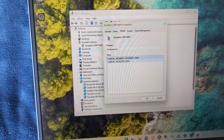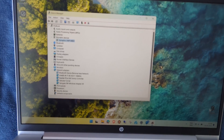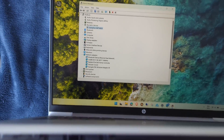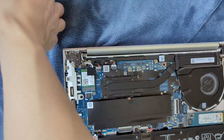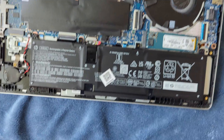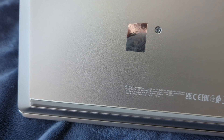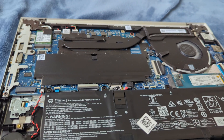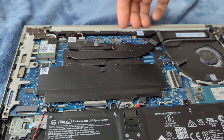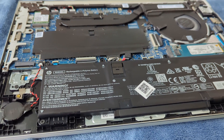I will put the driver link in the video description. Now with the driver installed, let's test it — it works! Now let's install the lid back. One tip when installing the button cover on the laptop: start from the bottom like this. The cover has some slots that it will slide into, then flip it forwards, clip it into place, and then screw the screws. When you want to take it off, the easiest way is from here, because if you try from the other side you may break some clips.